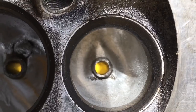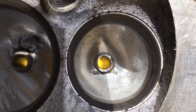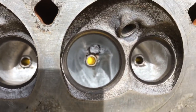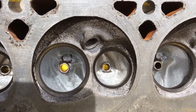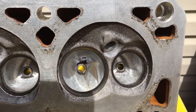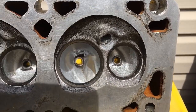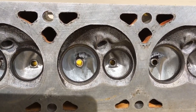That one is in a double cut burr finish for the entire port. It's ready for sanding rolls. I've just been trying to get the intake port smoothed out a little bit better. And of course I talked about earlier in this video removing the rocker stud lump.